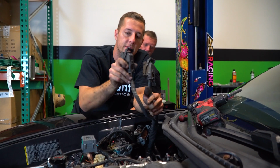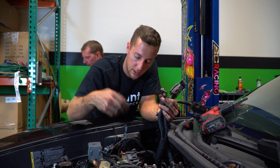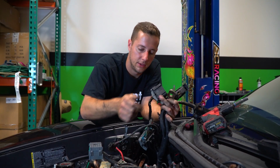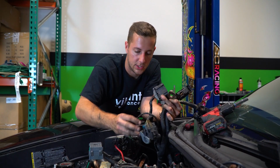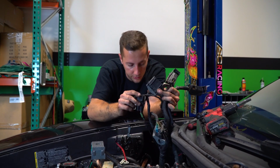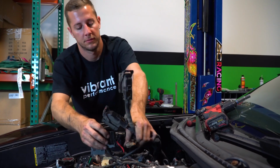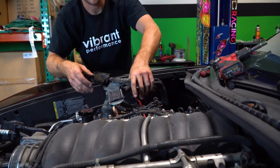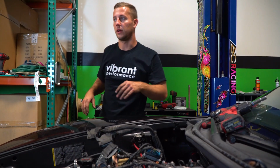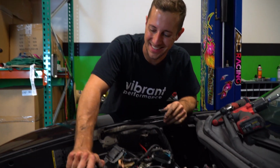These are our 2 ECU connectors. Those ones. This is our positive terminal, obviously came off. And then there's all of these connectors here, which are tucked up in here, right by the ECU. So once you get all those connected, you'll see that this is the portion that goes to your engine. Now we'll just go over here and drop everything. Wires, wires, wires. But when you disconnect this, you don't have to disconnect anything else on your drive line except for 1 ground above your rear subframe. Makes it easy. Don't forget about that one.